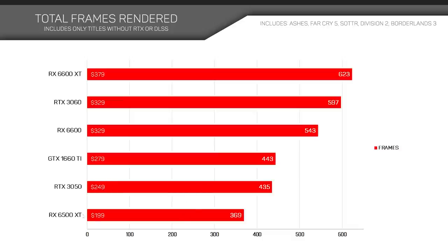It's even more fair if you consider the fact that the RX 6500 XT was really given an advantage here by being on a Gen 4 platform. If this card was slotted into a Gen 3 motherboard, we would see a performance hit of 15% or higher in some titles, as we've seen in countless reviews, simply because of this card's configuration. AMD decided to give it PCIe Gen 4 x4 instead of an x16 config, which definitely hampers its performance quite significantly, or it can at least, in a number of titles if you're running Gen 3.